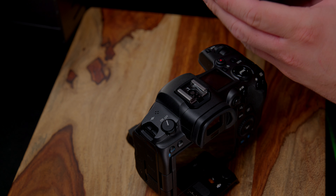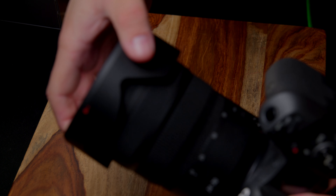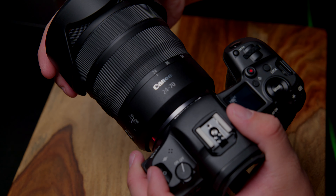This issue is definitely not exclusive to the Canon R5, but I wanted to share my CF express card experiences because we're always looking for the most gigabytes within our budget. Unfortunately, some of those cheaper cards may not work at all. For example, the ProGrade 256 GB was around $250, while the Sony 256 GB is around $450 — a substantial difference for the same size, but the Sony is significantly faster. If you want to do 8K RAW for longer than 30 seconds, make sure you get a card with at least 400 megabytes per second constant minimum write speed. Don't go below that — the camera outputs around 325, so 400-plus is where you want to be.